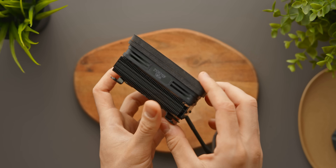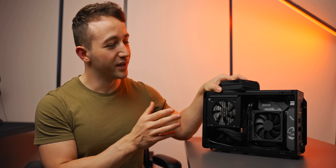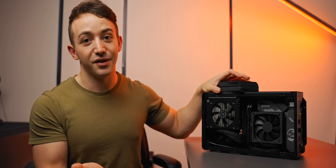But does it actually result in better performance? Here with an 11600K running at 90 watts continuously in Blender, we've got all six cores averaging 89 degrees C after 20 minutes without the fan duct. With the fan duct installed, we drop about five degrees, getting us closer to some more comfortable thermal performance. Five degrees isn't anything crazy, but for what is probably one of the most simple cooling mods you could ever do, it's 100% worth the $13 or so that Noctua are charging here.